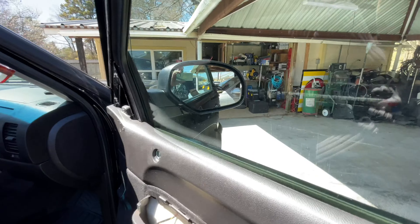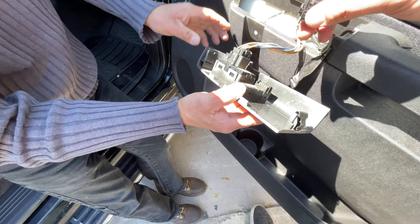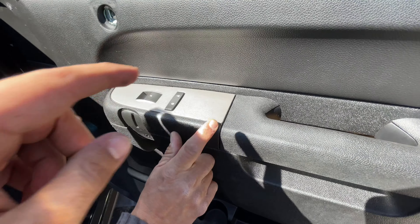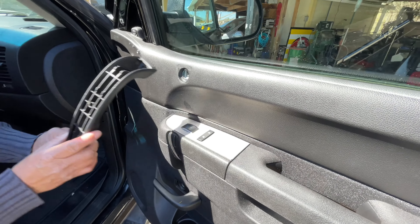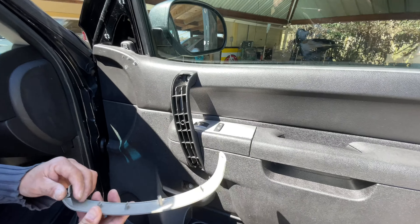Go over this first — line it up at the top. It may take a couple of tries but that's okay; take your time, patience is key here. You don't want to go too fast and break anything. Clip the door panel into place. Now we have a mirror. Grab the master switch or passenger side switch and plug it in. Make sure this one goes back into place — the little tab is on the side so it goes like that. Push it in, then line it up back here first and push on the front. We'll put the handle and screws back — fast forwarding a little bit.